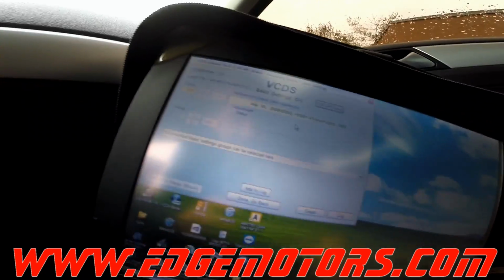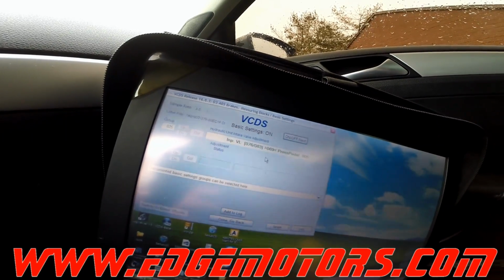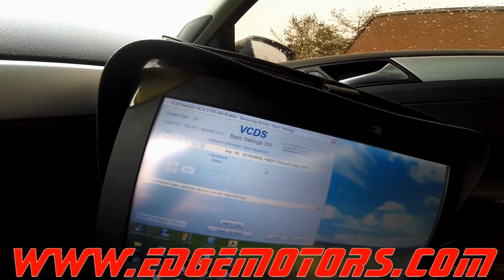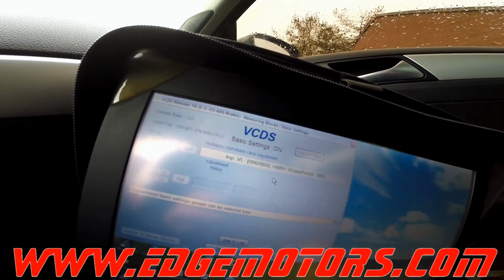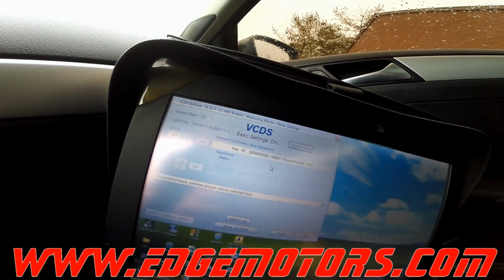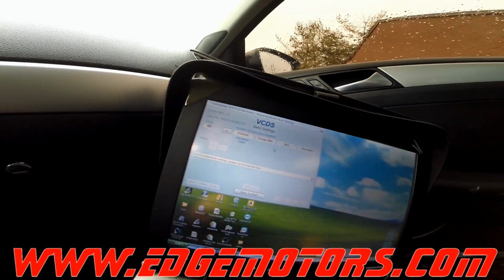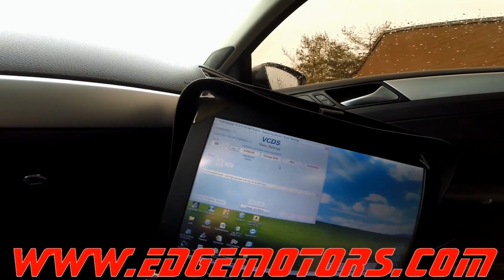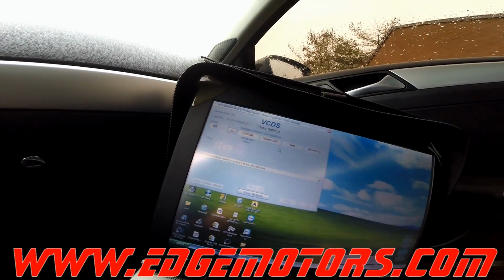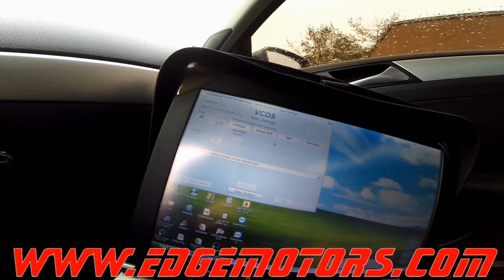But your main idea is to keep on bringing these numbers to the specified window range until it says that it's done its basic settings. See, it locked out again. Yeah, we have to cool off the car in order to continue. So if it's kicking you out like that as well, just shut off the car and let it cool off completely.